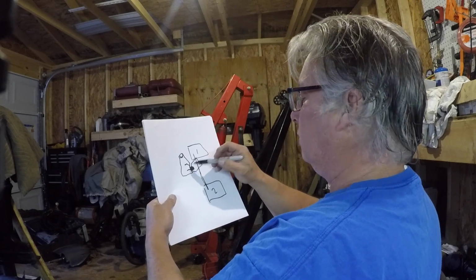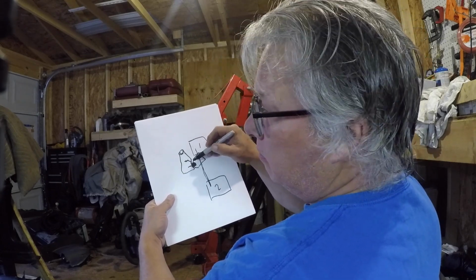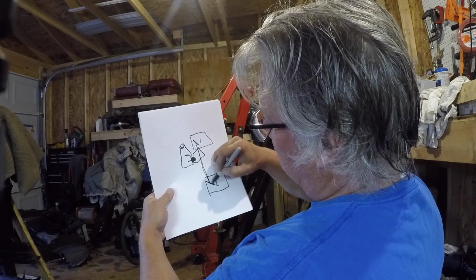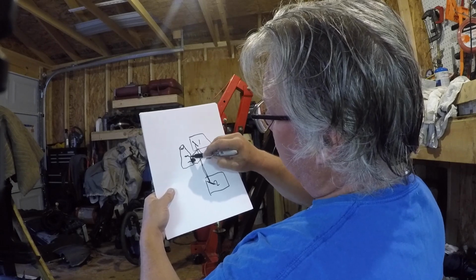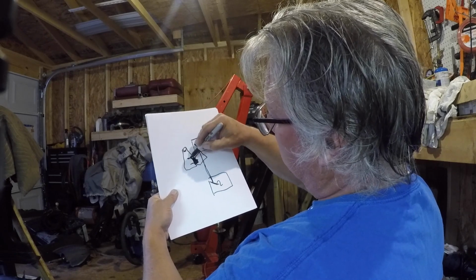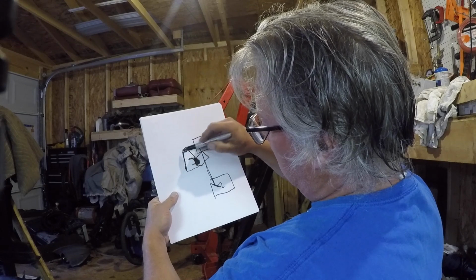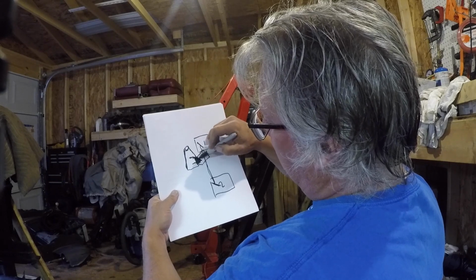So normally, this is what they call a primary pickup, because it's just touching this linkage which controls the venturi in here. You want this to just crack. So this should be more up here, and they say to be right in the middle of that. If that helps anybody, I don't know. I noticed there wasn't a lot of videos about this, so I was kind of surprised. But that's going to be kind of like that.